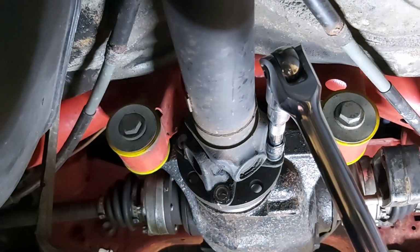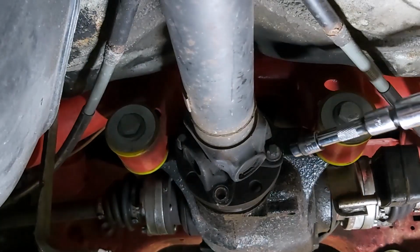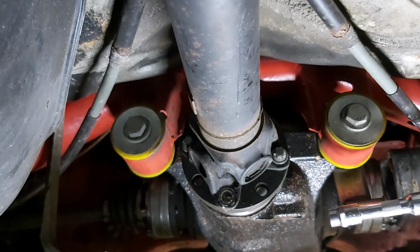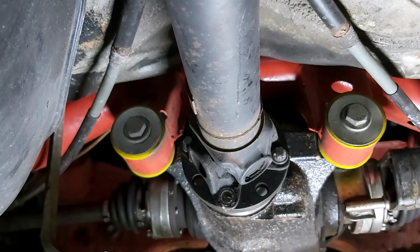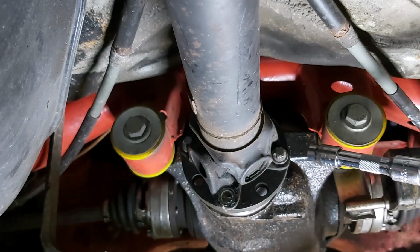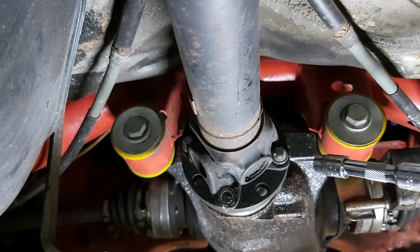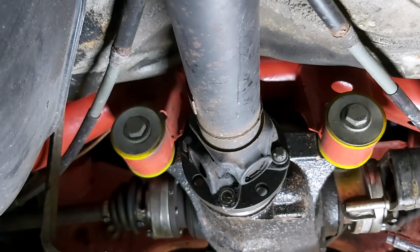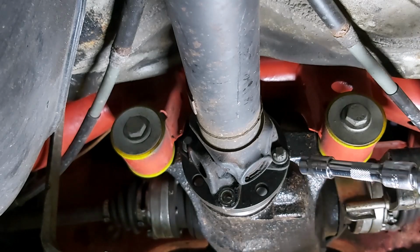Okay, now check the manual. It turns out these bolts are angle tightened. I'm going to have to get some new ones. I'll have to race around tomorrow and sort them out. Same with the final drive ones. I think they're both stretch bolts, and you stretch them based on an angle. I'm not going to risk anything, not on a retirement from a race. Sure you can understand that. I think they'll probably go another time, but I'm not going to risk it.